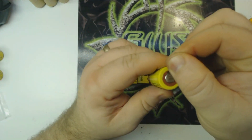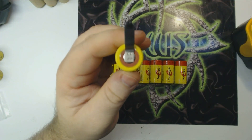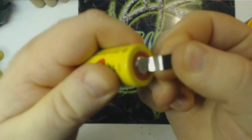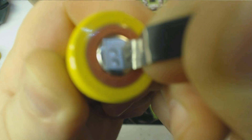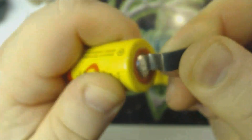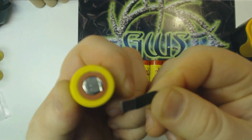In order to remove the tabs you can do one of two things: you can take your wire cutters and just cut the tabs. What I find easiest though is to take it and bend it as far back as it'll go, all the way back to where it's welded on there, then just fold it over and back a couple of times quickly. It just comes right off.